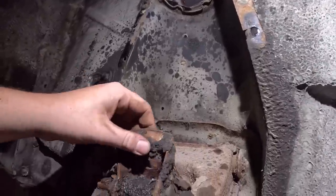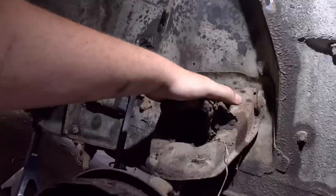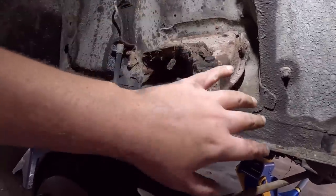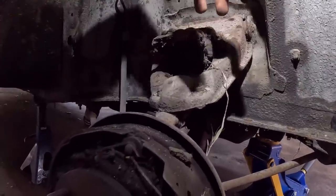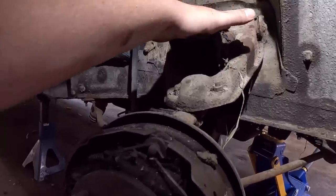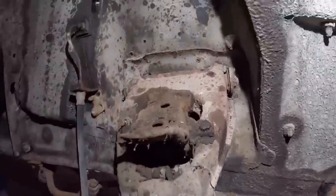because everything is still in good shape, everything rides on the upper control arm on this setup. I mean, typically, most of the stuff we work on, the pocket would be in the frame itself, and the spring is in there pushing down on the lower control arm. So all the weight's on the lower control arm, and the upper is just a follower. In this case, it's the other way. All the pressure is on the upper control arm, and that's that. Now,